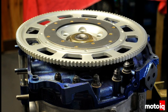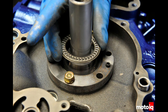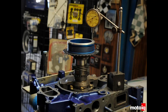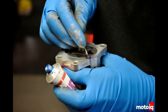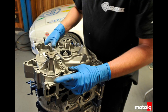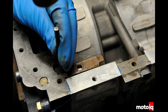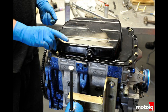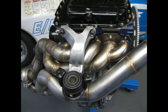I would love to see more of these Renesis hybrids out there, but I think a limited availability of exhaust manifolds — meaning you have to make a custom exhaust manifold, whether you're running naturally aspirated or turbocharged with a block configuration like this — as well as a standalone ECU, have kind of limited how many combinations like this you see out there. There were shops in Japan, shops in other Asian continents, as well as Australia that played around with these ideas, but we just haven't seen a lot of this configuration. However, from the dyno chart numbers and the success of this project, it is a very viable option for RX-8s, and more people should look into doing a custom multi-port exhaust Renesis hybrid motor.